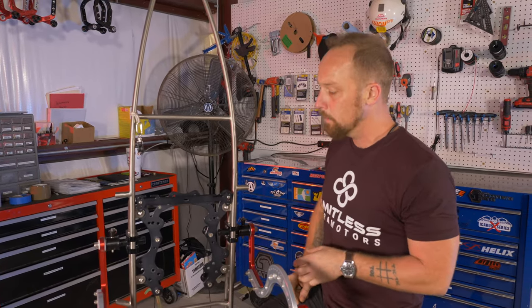Okay, so what we just did is set up for a Moster 185. We're gonna go with a bit higher total control system, again, to get that pitch forward a little bit more stabilized, slow that down a little bit, and give it a bit of torque compensation offset. It's gonna give it a little bit more stability with this TCS being up higher.